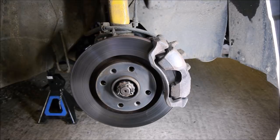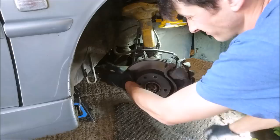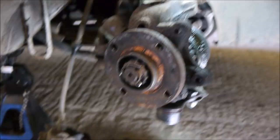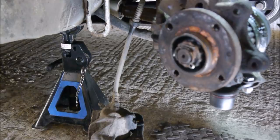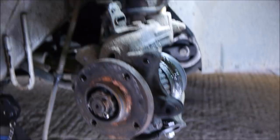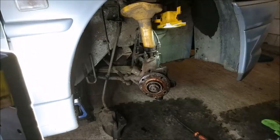I've shown you the brakes I want to put on — I'm just going to rip these off and test-fit one of the new brakes. As you can see, it looks like we've got a split boot, so that will be coming apart very soon for a new boot. In the meantime I'm going to have to clean up that hub face quite dramatically. I wouldn't normally leave a brake caliper hanging like that as it can damage the brake hose, but the brake hose is coming off so I'll leave it there for now. I'll clean up there and get a bit of a soak clean, test-fit the brakes, and we'll start trying to get the brake pipe apart — which could be fun. Goodbye, old brakes!